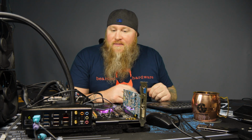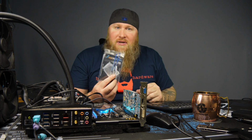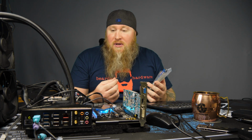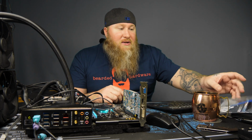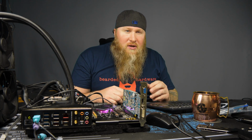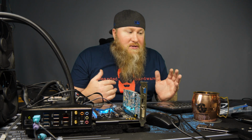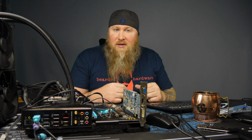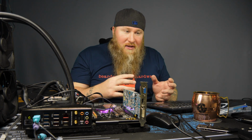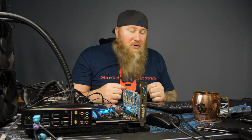But anyway, this RockitCool kit with the Quicksilver definitely works killer. It's an awesome kit. I highly recommend it if you want to go through this battle. Overall, for the temp difference, I'm not sure if it's totally worth it for the extreme guys, or for someone who's going for the ultimate performance on a chip that they're willing to lose warranty on. I think it's definitely worth it, especially with that kit for taking the solder off, because I've delidded a CPU before without the solder remover and without the Quicksilver, and trying to sand it gets a little sketchy. So overall, it's a pretty good product.